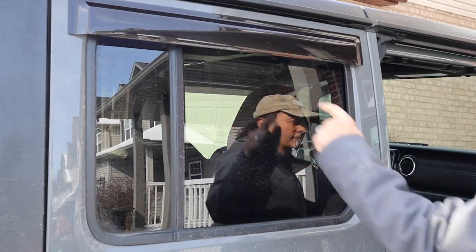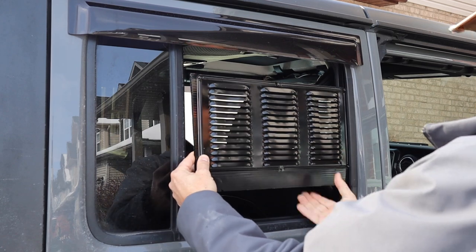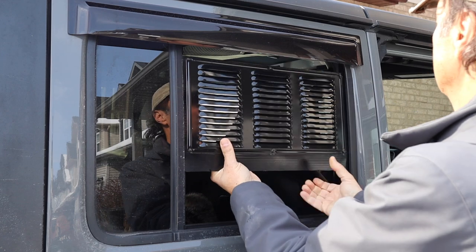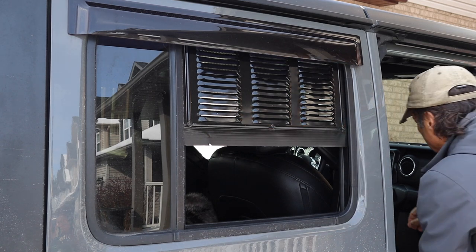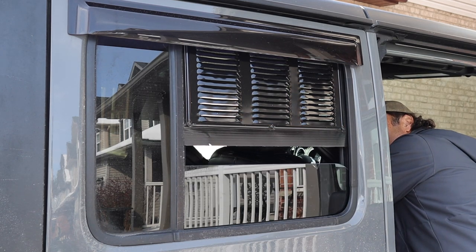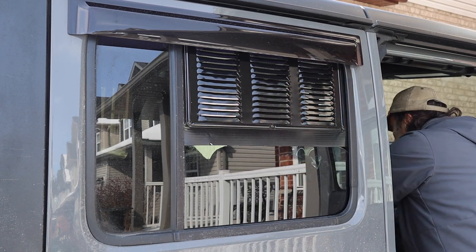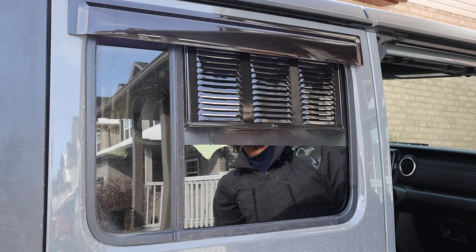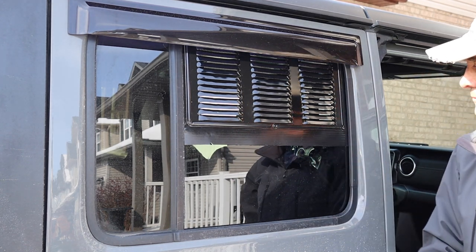Installation is very simple. You just lower the rear window and fit the vent in the groove of the slot that the window occupied, then move the vent to the top. As you roll up the window, make sure that the skirt at the bottom overlaps over the top of the window so that any rain coming down the side of that vent will continue down the glass rather than get into the Jeep. And here's a view from the back that shows how that overlap skirt works.